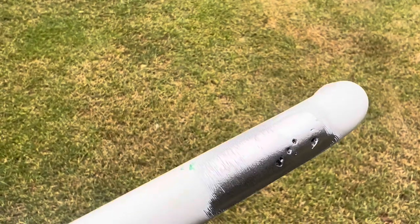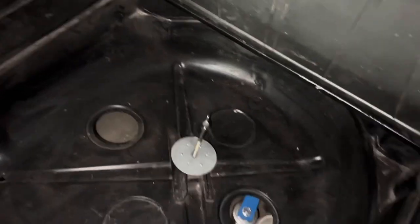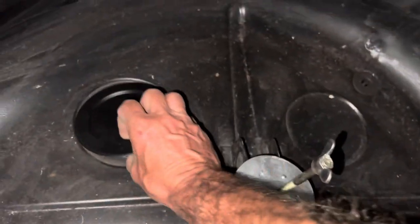Just before we can glue that patch on, we're going to sand off all the primer undercoat because we're gluing bare metal to bare metal. When you're using panel bond, it's always a good idea to do other jobs at the same time so you don't waste the glue in the nozzle. When you buy a new panel — this is a new rear boot panel for the SL — it comes with two big holes and you have to actually buy these sections separately, so we are just going to panel bond these in.